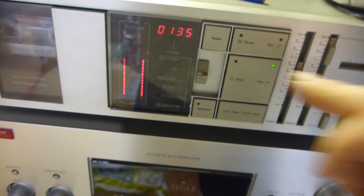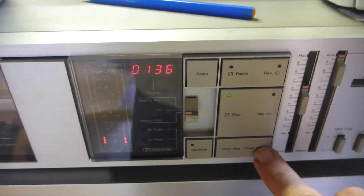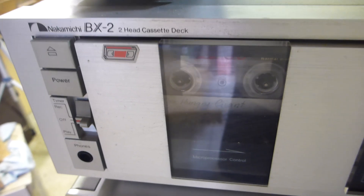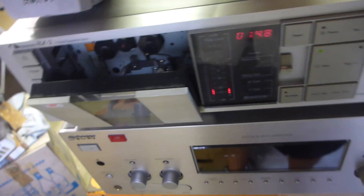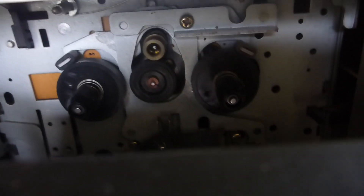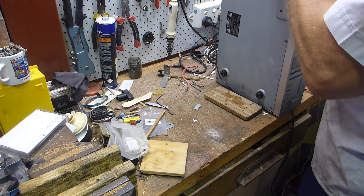What I can see is happening - the capstans aren't spinning evenly. Also rewind and fast forward: if I press stop then rewind, basically very little is happening. There's also a logic problem with the fast forward - it tries to fast forward but it's just playing slower than even play would. And on rewind, basically nothing happens. I think the problem is a capstan wheel or drag wheel that transfers power - it probably needs a rebuild.